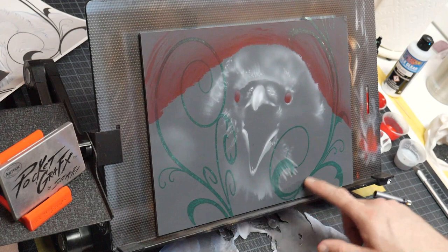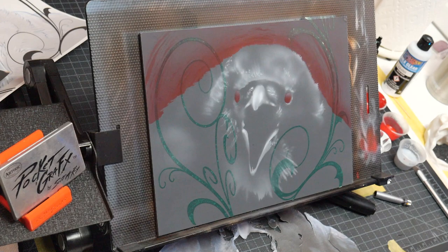The second one is their blue mask, which used to be called Le Bleu, and now it's just blue mask. That is one of the most flexible and thinnest vinyl masks on the market. So you can stretch it over anything. It's thinner than any other mask from any other companies. So super low profile. So when you build a lot of paint and candy on it, you don't get a thick edge. And then we have this mask now, which is the green mask, which is arriving soon. So everyone, you should be seeing it soon. It's coming on the boat. And nice about this stuff, it's as thin as the blue. Sticks like the blue. Stretchy. Super nice.